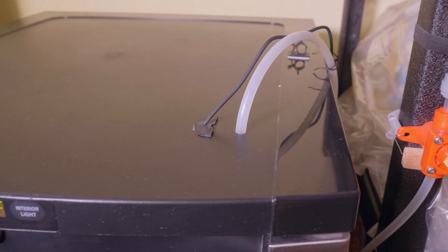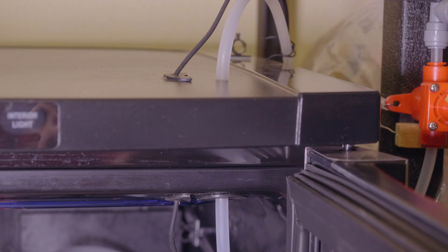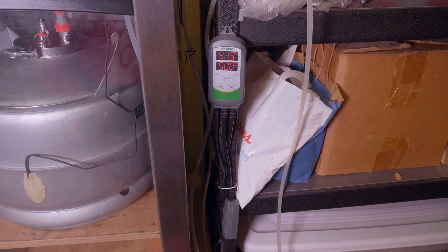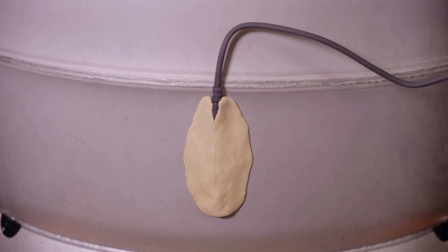Here are some detailed shots of how I got the tubing out of the fridge. On my fridge it was best to be in the very front. You can see I pierced it just by drilling through the top and then drilling through the bottom. I made the hole pretty tight so it's pretty much a pressure fit on the outside, and I did seal it on the inside with a little piece of rubber. I'm also using an Inkbird temperature controller. This is the inside temperature probe which I've used plumber's putty to attach to the fermenter. My wine fridge only goes to 65°F so this helps me get above 65 when I need to.